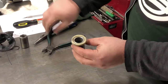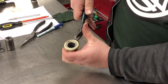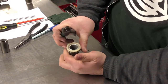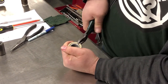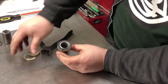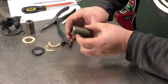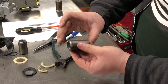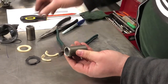The good thing on the 360 is it's a lot easier to take apart than the 350 ones. I'm just going to clip it here, a clip 180 degrees apart, and hopefully they should come off without a problem. There we go — nice clean cut. I'm going to hold it so it doesn't pop apart on me. And nice clean cut too. Done. That groove on this one looks pretty clean — a little dirt in there, I might hit it real quick with the Scotch-Brite, but overall pretty clean. Same thing as on the 350 — there's that groove where we're going to put the new diaphragm on.